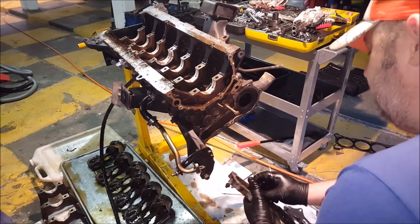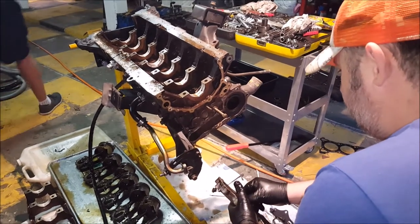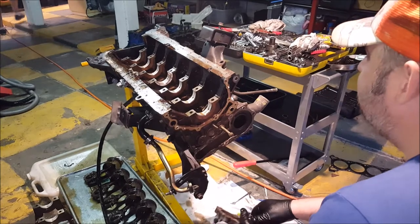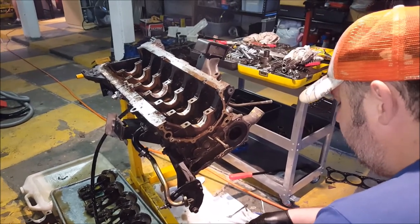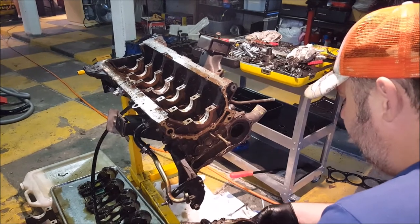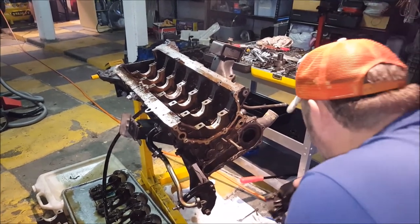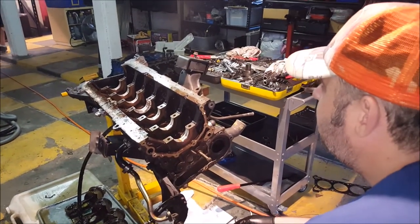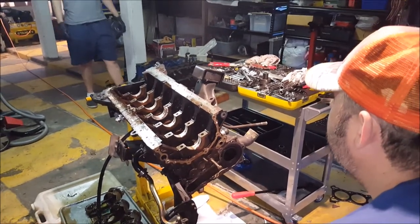Could anything in the head be making that noise? You would have seen it. Just the valves. It's only the valve and valve springs left, and you can't depress the valves. If it had a broken valve, it would make a different noise. It wouldn't be so deep a knock, I would have thought. Anything visibly wrong with the valves or anything like that? Nah, nothing visible, on either side, underside or top side.